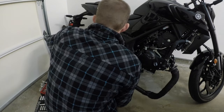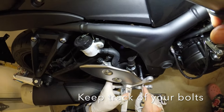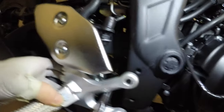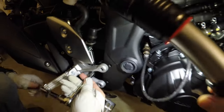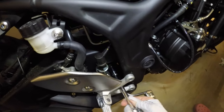To give you a hint, you might want to attach the front first — I went through quite the exploratory procedure. We got everything lined up, so now we're just going to tighten everything back down. There's a 12mm bolt inside here behind the brake, at your right foot peg. Make sure you use the spacer, the offset, the washer, and the bolt.